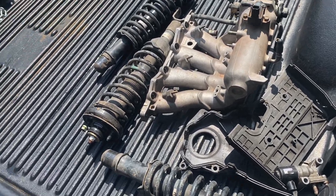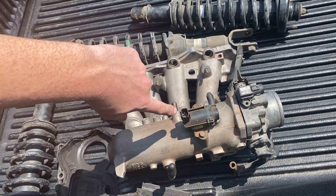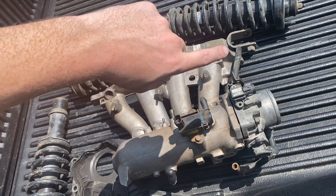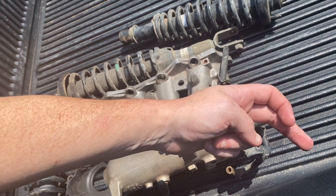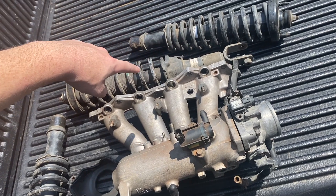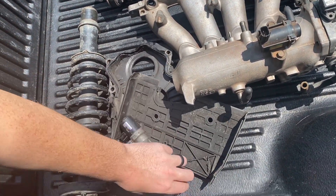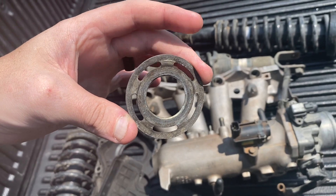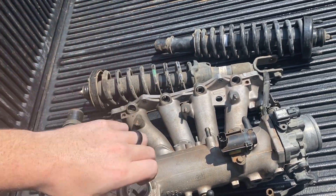In addition to that, this is a P-75 which comes on a '94 and up Integra. This is actually an OBD-2 — it's got the little emissions solenoid on top. If you pull this off, it's just a direct port into the intake manifold. We've got a throttle body that now supports the MAP sensor, whereas the other one was an OBD-0, which is firewall mounted on a DA Integra. So we've got the right throttle body now. We're going to clean all this up with new gaskets. And way down in here, I have this mysterious ring that was missing — this is what was allowing the timing belt to walk off the end of the cam gear and the crank gear. We'll put this on; it's got a concave to it, and it'll stop that from happening again.